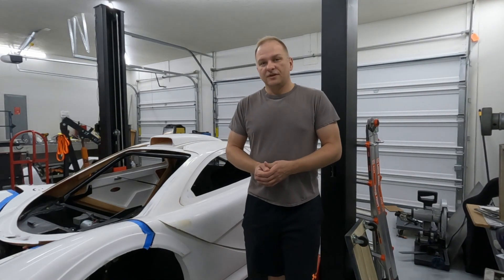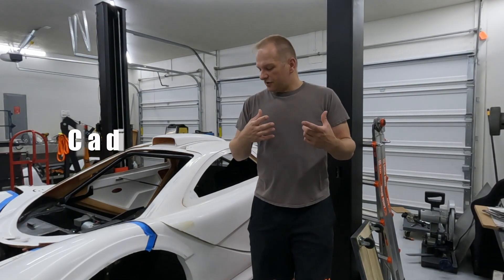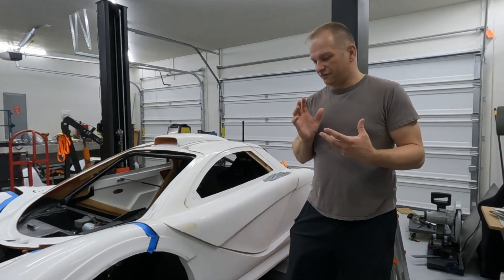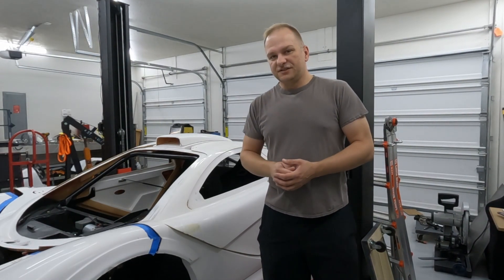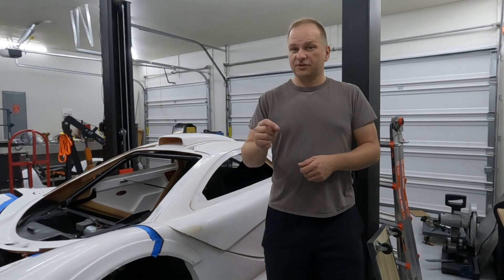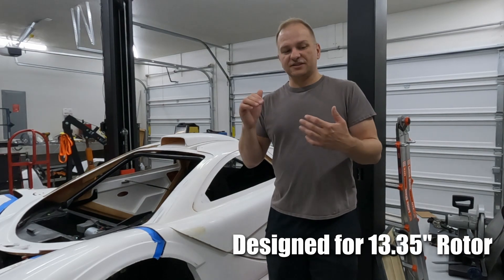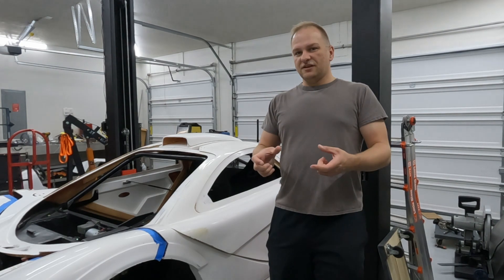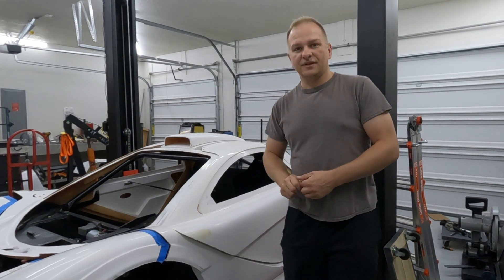What I did find in that course was that the Cadillac ATS-V front brakes are four-piston — but very large four-pistons. And you use the C6 Z06 rotors and put them on that. You do have to modify the caliper slightly to clearance them. They're not designed for 14-inch brake rotors; they're designed for something slightly smaller. But there's enough meat on there where it does not compromise anything, and you can actually just grind it down to accommodate the larger brakes. So let me show you what we've got and go from there.